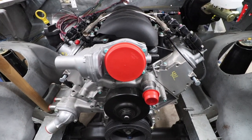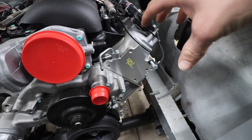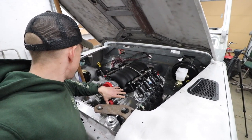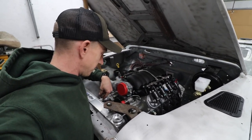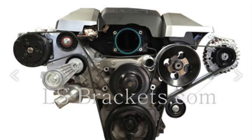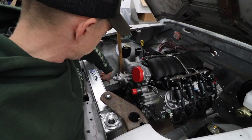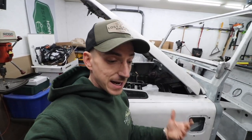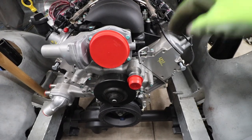Just wanted to say thanks to a couple people that reached out about some other options for our front drive. We had a couple people recommend LS brackets and I believe that is the route we're going to go — I do like the simplicity of them and they've got quite a few different options. We're going to measure some things out. This is the one I think we'll use, but we need to measure first because we have a steering gear that is going to go here — it's not over there anymore because it's left-hand drive. So we need to make sure things don't try and occupy the same space, because that is not possible. Hopefully soon we'll have those brackets to get that sorted out.